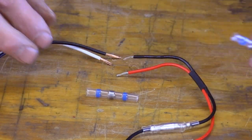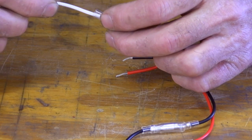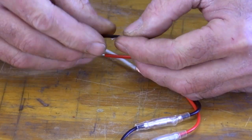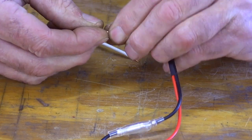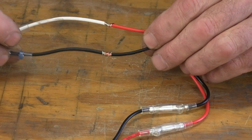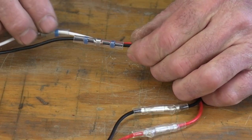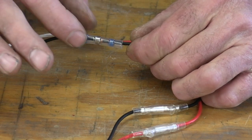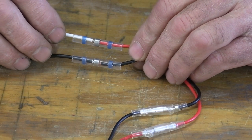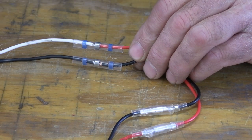We'll connect this side of the wiring harness to the wires coming out of the light with these supplied butt connectors. To use these, just take one, put it over the wires, slide it back, and take your wires — black and black — and twist them together. Then slide those connectors back over and get this silver ring right over those twisted wires. That's a little bit of solder. We're going to take a heat gun and heat these up — you can also use a lighter or even a really hot hair dryer — and that's going to melt the solder into that joint and shrink the tubing down to make it waterproof.